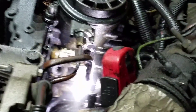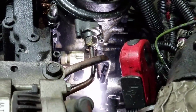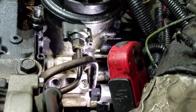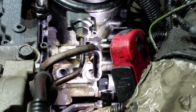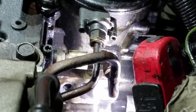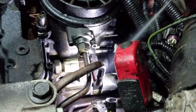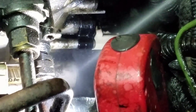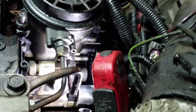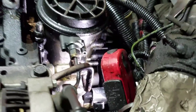Now all we're going to do is pretty much just brake-clean all this stuff out of here. The brake clean and everything is going to come out the back of that plug, so we'll have totally clean fitting holes. Flush it out with that brake clean — get that back plug — get that with the brake clean. Now it's time to prepare all three components for their new O-rings.